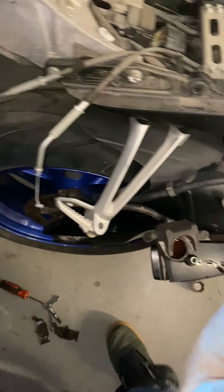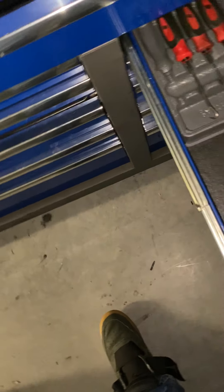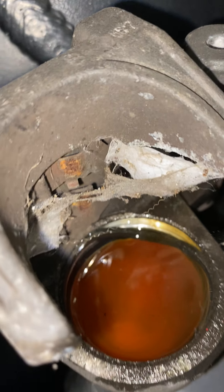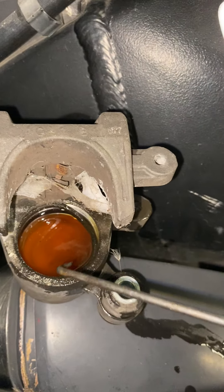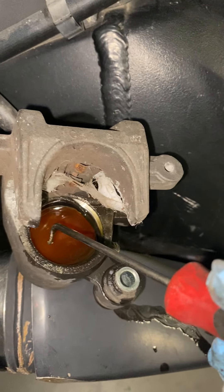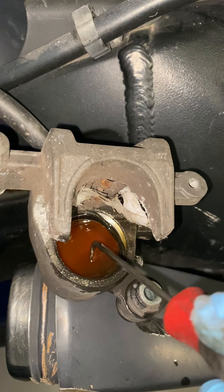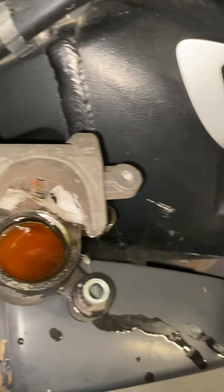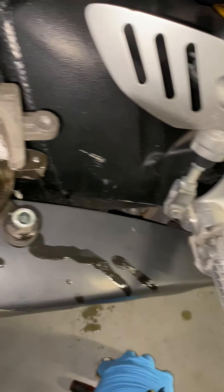It's always good to take the seals out. You can get your pick and remove the seals — try to get behind it, careful not to damage them, because you can reuse these. But if you can order new ones, it's best to be safe. Another thing: whenever you see the fluid looking dark like this, definitely change it. Brake fluid is hygroscopic — it collects moisture. Moisture is bad because when that brake gets hot, it's gonna misbehave, and we don't want the brakes misbehaving — that's your life.